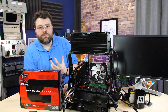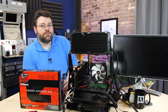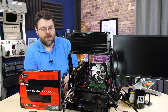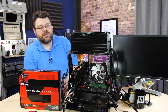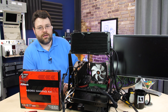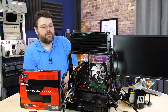I've got an ASUS Strix Fury — it doesn't really work with re-initialization after the fact. However, if you've got an NVIDIA 960, 970, 980, 1080, 1070, or 1060, most of those work fine for re-initialization. But NVIDIA has taken a hostile move where, in their drivers, if they detect they're running under a virtual machine, they just exit. So in your virtual machine, you have to tell it to lie to the guest operating system and say we're not running in a virtual machine. Then the NVIDIA drivers work completely fine. So if you're willing to do that, you can totally use an NVIDIA graphics card and be completely fine.